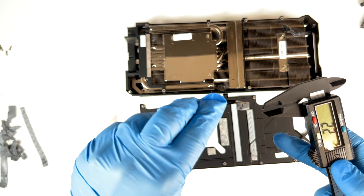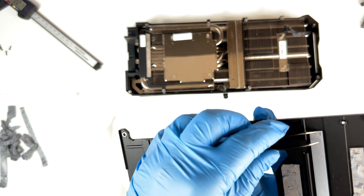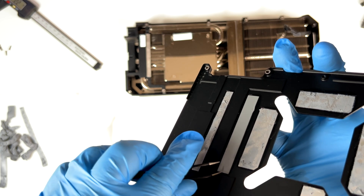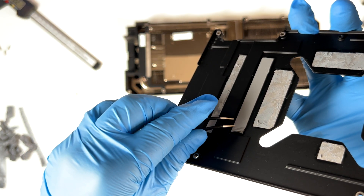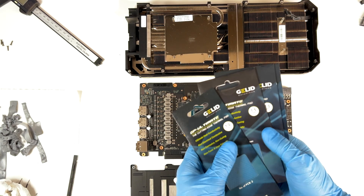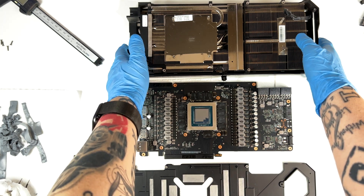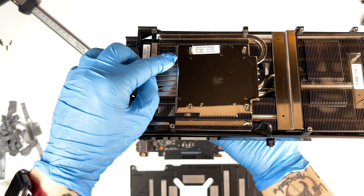So they probably have been using a pad of 2.5 millimeters. And then we have these small pads here that I believe they are 0.5 — yes, they are 0.5. As we can see, they are extremely small. Now I'm going to cut the thermal pads. Here is one nice thing on how you can easily apply the thermal pads — we have all the shapes here.